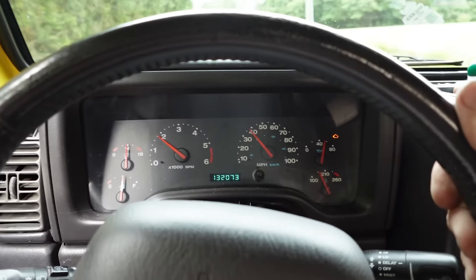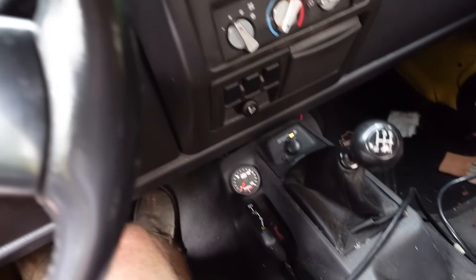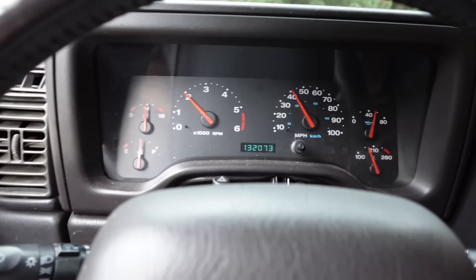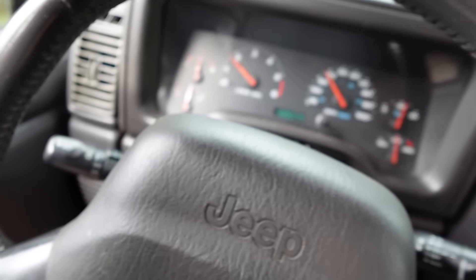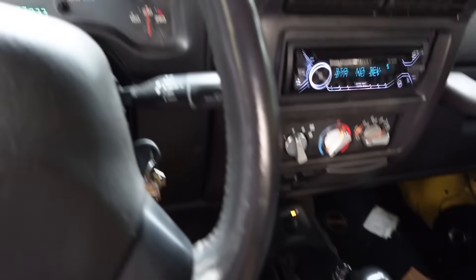Oh yeah, big — I'm gonna drive around, see what code it throws. Check out this RPM graph — it's showing crazy sine waves. This thing is a 5-speed manual, so that engine cannot possibly be actually doing what the graph shows. I think it's a crank sensor. I've got it back and there's an inconsistent output — you can see the hose shaking; there should be able to see it in the window. And the crazy part: there's no check engine code.